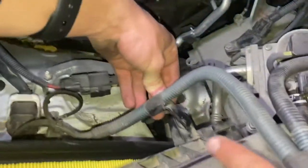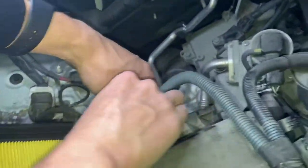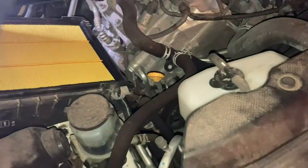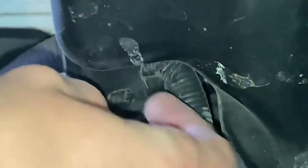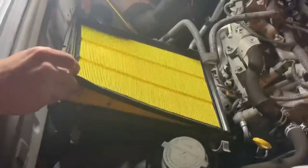This hose is also attached back here with tape. Ours has tape on it; yours may not. If yours doesn't, you're just gonna have to take this guy out. The little thing holding it — you have to pinch it on both sides. One side's already pinched; pinch the other side and let's go. Remove the flat air filter.